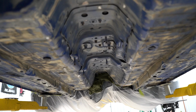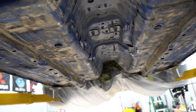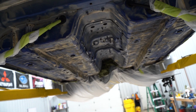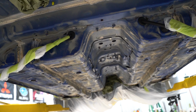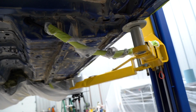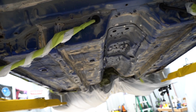So yeah, the plan is spray down the epoxy and then wait about an hour, hour and a half, 2 hours, doesn't really matter. Anytime before 3 days, I'm gonna come back through, mask all of the threads just because that Raptor liner is super thick. So mask all the threads and then spray down the Raptor liner. This is exciting. This is how she looks, completely bare, scuffed. Already went through with the wax and grease remover. But yeah, let's lay down some epoxy.